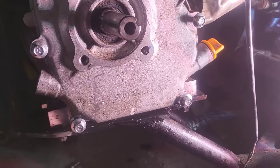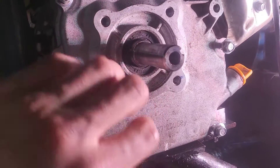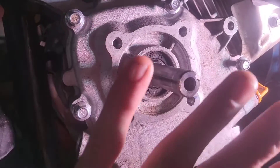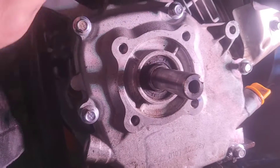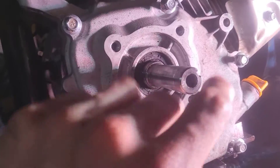Smack the cover back on there — it takes a bit of persuasion. As you tighten the bolts, it's similar to doing a tire or a head so that you don't warp it: go gradually so it's tight, and then once they're relatively tight, go this one, this one, this one, this one — and then torque them down from there.